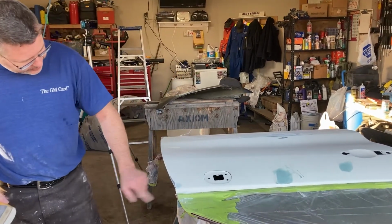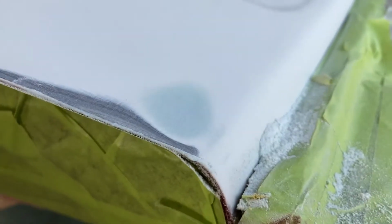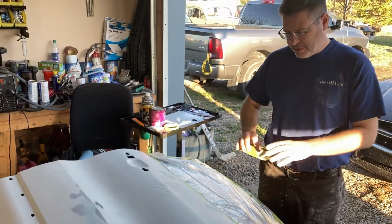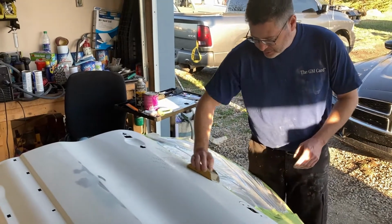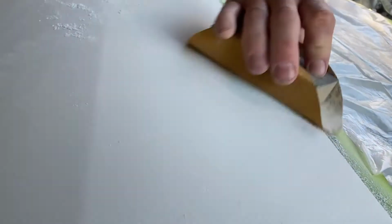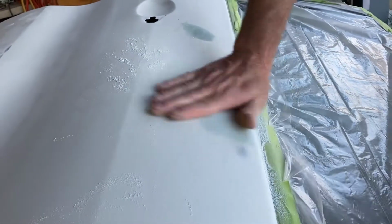Okay, a few more spots and then we'll start on the fender. Nice and flat there, yeah. And we'll do a couple more under the fender. Nice. Okay, I'm still working through this, and another tip I want to give you is let the paper do the work. You don't want to be just reefing in there and digging on this. You just want it to cut in so that it's just using the block itself, and it'll smooth itself out. Like I said, kind of do an X pattern, a little bit this way, a little bit that way. And you see, Mike, we've got that other low spot over there now, right? You see how it's nice and all flat colored now? Yep. So when we hit that with a smoother grit, it'll just smooth it right out.